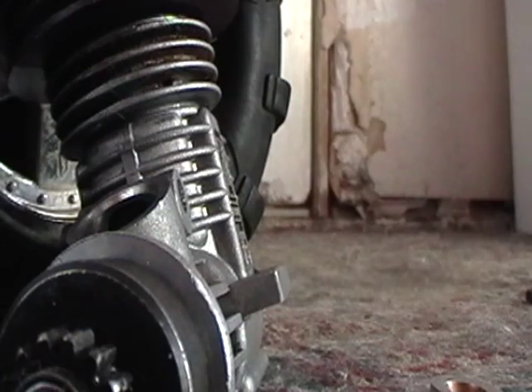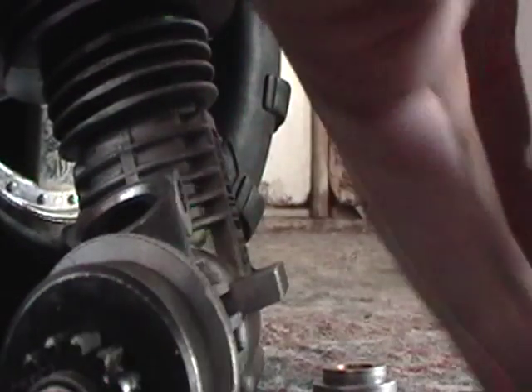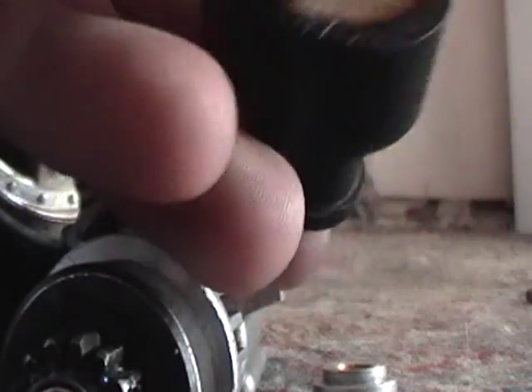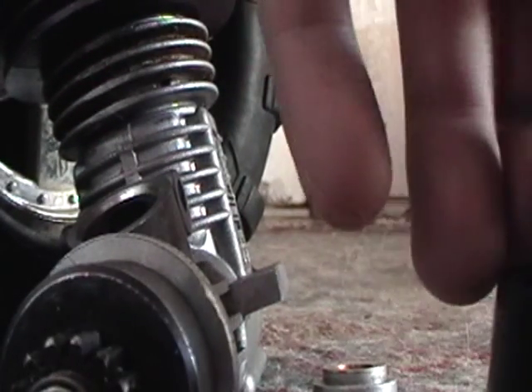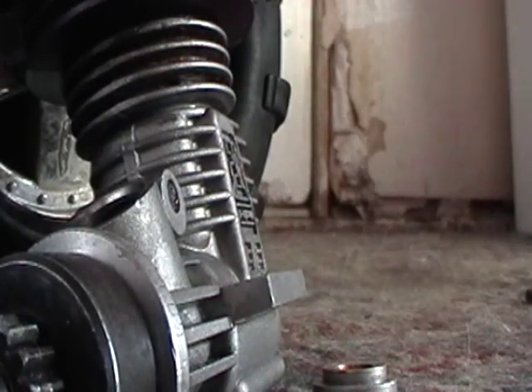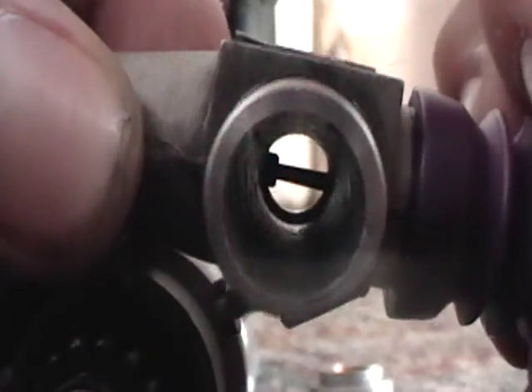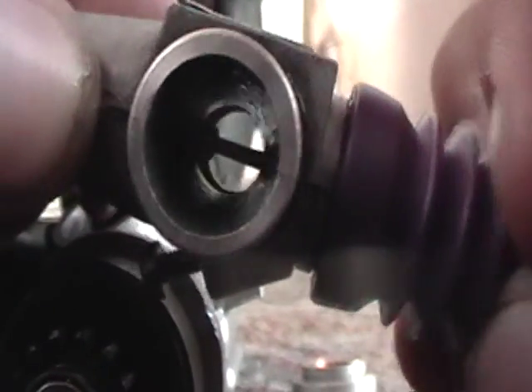Just pull off the air cleaner — it's just a foam sponge. It's supposed to sit really nice in there with no openings, like that. It's a little plasticky piece to keep it in there. Air comes in through the Venturi like on a normal carburetor, goes in through here into your crank port, and there's a slide to control your speed.